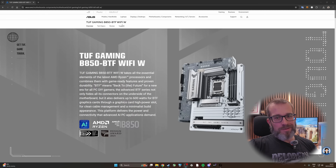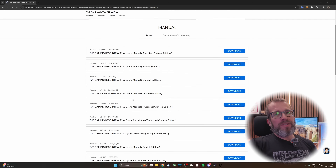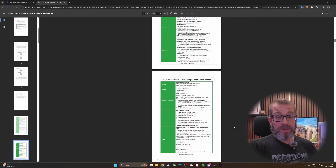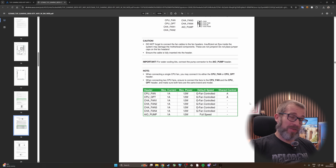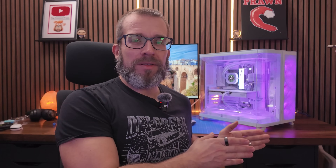The point of this video is to highlight that you should think about the fans you're connecting, the specs of your motherboard, and how much power your fan headers should actually output. You often have to go to your motherboard manufacturer's website, find and download the manual, and search for the table showing power draw specs — it's not easy to find, but it's worth doing. And this isn't a Corsair-exclusive problem; I've seen plenty of other cases with three ARGB fans connected together that expect you to connect directly to the motherboard.